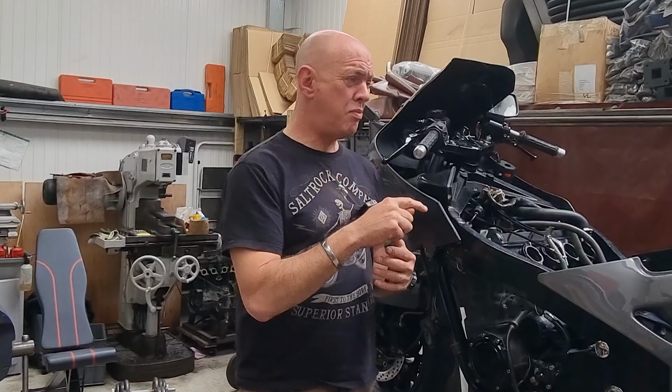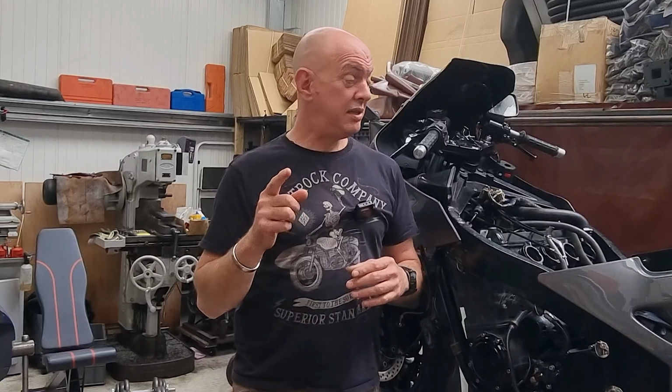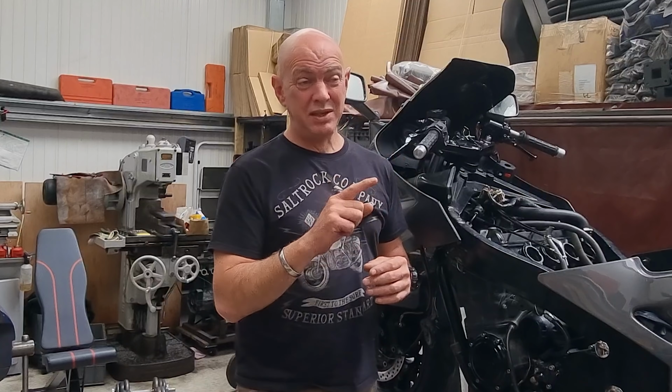But they've all gone back together again anyway. I am at the minute looking to get some different jets. There was a very helpful fella who tipped in going, I have one of these, and I had an aftermarket exhaust and air filter and stuff, and this is the jetting that I had. So I'm looking to see if I can get the same jetting, and I'm tempted just to bung it in now, because we know that we're lean.